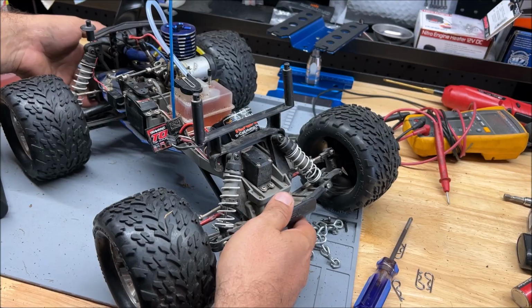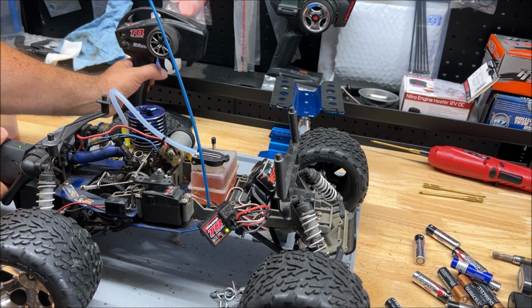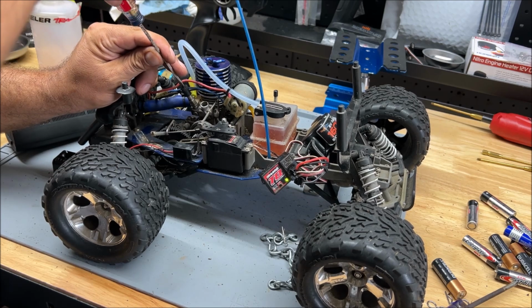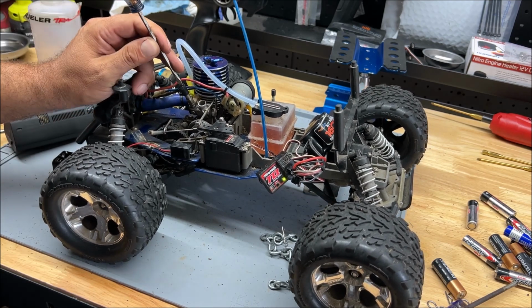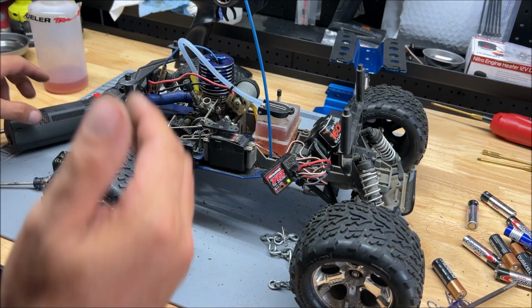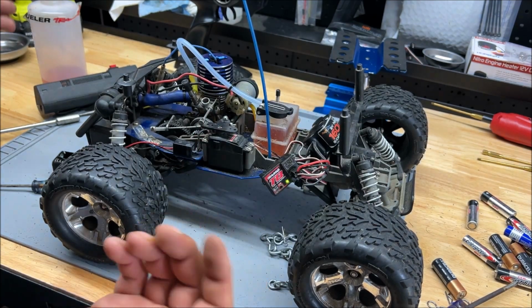We already blew into the pipe to prime it. The one-way bearing's bad. One, two, three. So I got it 3 turns out. I think this one's supposed to be 2.5, right? He did have the idle gap as low as it'll go on this one.